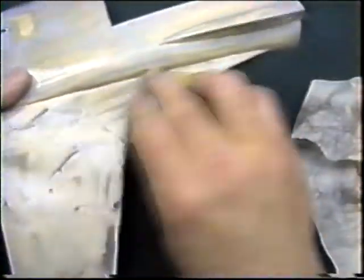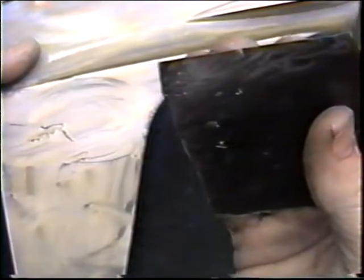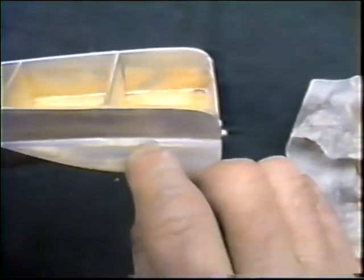What's worth mentioning here is when I'm all finished, I get rid of the block and just go over everything again by hand. A lot of people — when they're sanding out their first silver — want to know how much to leave on. Well, obviously you don't want to sand it all off and defeat the purpose. You just want to leave it in the low spots. I know right there there's a low spot I need to work on. This little piece here — I know I'm going to get a little of the green putty in there. Once I get done with the hand sanding, give that ten minutes to dry and you can sand it right out.